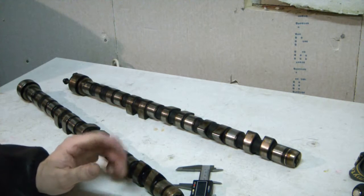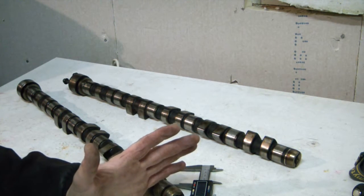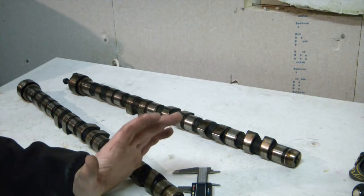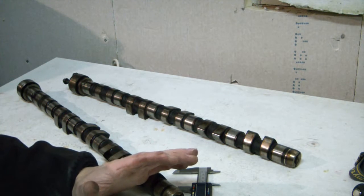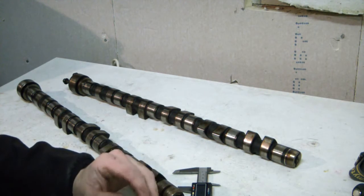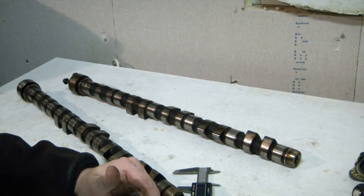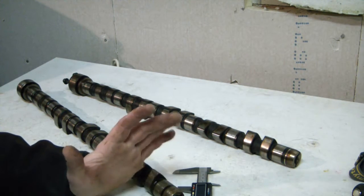The main benefit of doing this mod is that while you are at high revs, you will be getting more air coming through, and the effective working range of the cam is higher. So you'll actually be moving the power band of your turbo engine up perhaps 500 RPMs. The power surge will come 500 RPMs later, but then it will be much stronger at high revs where the engine really starts to pull.